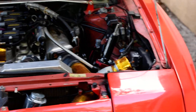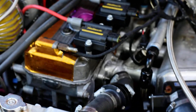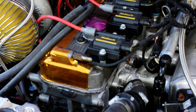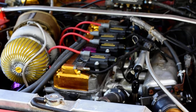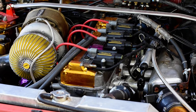I'll definitely keep you guys more up to date and post more on the build. And also it's a stock long block — stock rods, stock pistons, except the head. It has a mild cam. When it comes to these motors, a mild cam is 276, and for me that's still too small. I actually have a cam with a 583 lift for a race motor that I'm building.